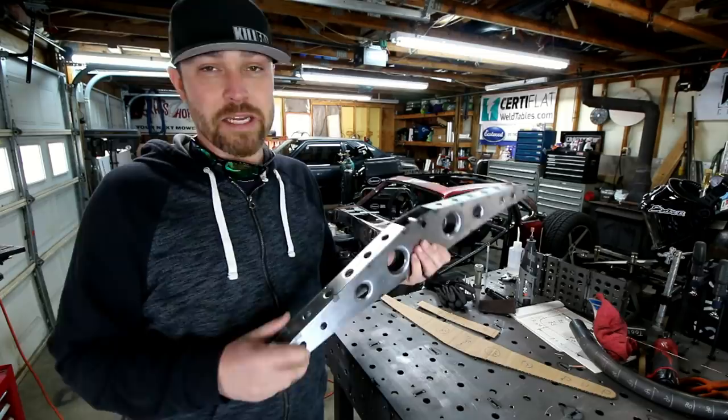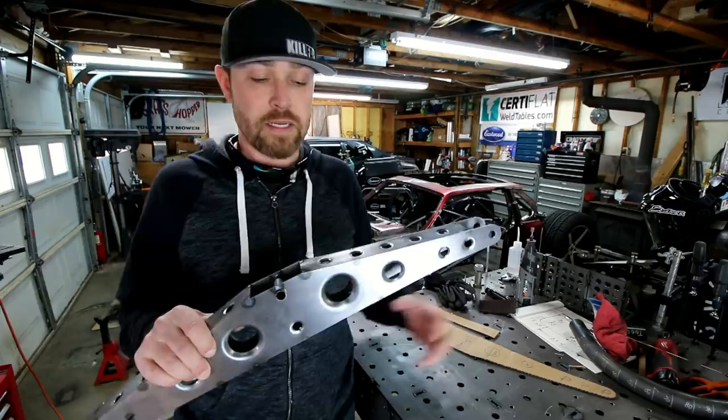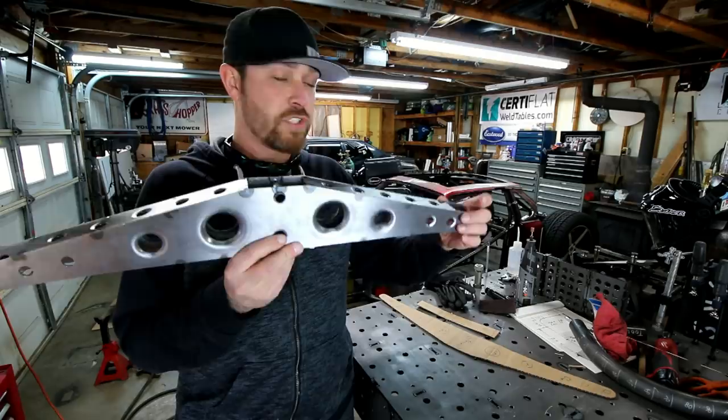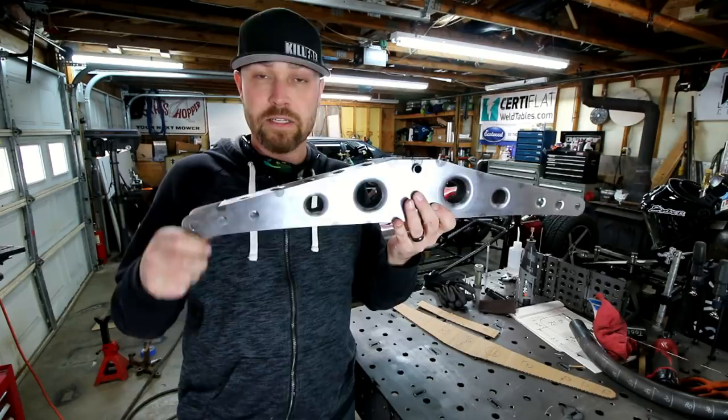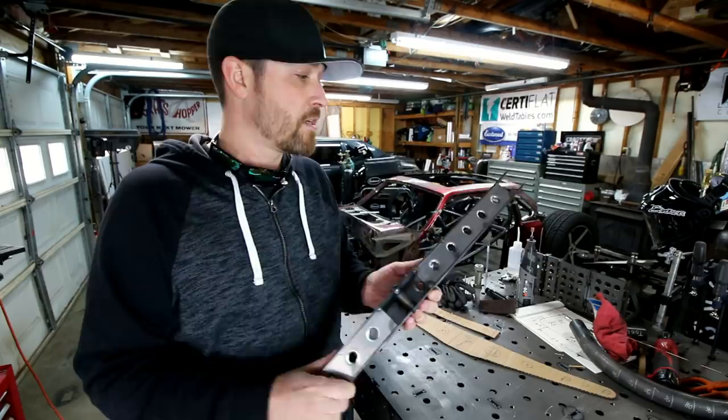It may be like that on the front, but for the back, the whole idea behind running a cantilever suspension wasn't to relocate the shock and the spring. It was to be able to actuate the ride height of the car. So you have shock and spring out here, pivots in the middle, and then you have the hydraulic cylinder over here, and I can manipulate the ride height just with a hydraulic cylinder, but still have that amazing ride quality of a shock and a spring versus air. So that was the idea behind this. Plus, it just looks damn cool.